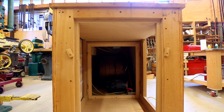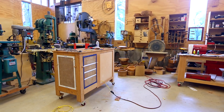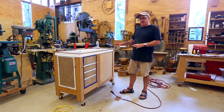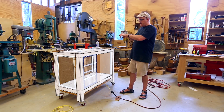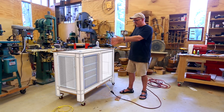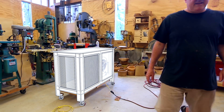If you look past the filter you can see into the space where the fan is with the motor — it's all pretty simple. The structure is basically a torsion box at the top and at the bottom, and those are held in place by the four corners. The four corners are each made out of two pieces of plywood screwed together to make an L, and those wrap the boxes and make the basic structure. Once you've got that you just have to enclose that space and divide it in the middle, and you get a space for the fan and a space for the plenum for the air to come in, be filtered, and then shot out by the fan.